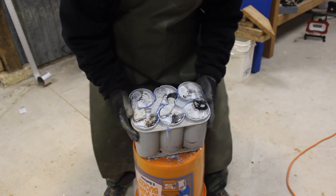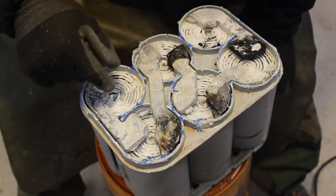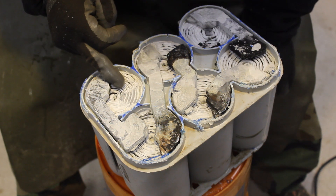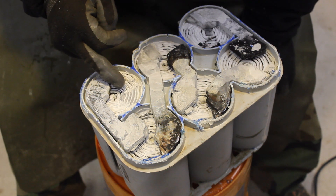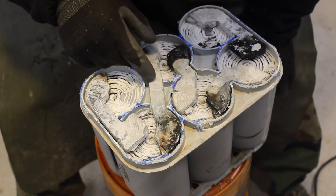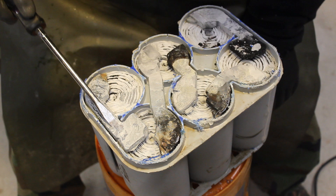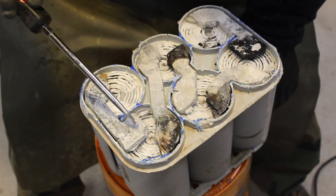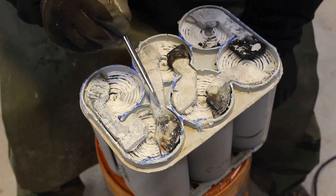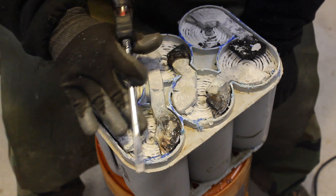We are in. You can see how each one of these little packages are rolled up, and you can see there's two layers of fiberglass mat and two layers of lead, tightly packed into this cylinder. And just looking at this, there does appear to be quite a bit of corrosion and even some deformity here — I don't think this was caused by me breaking this battery open. You can see that these connecting sections seem to be a little bit warped.